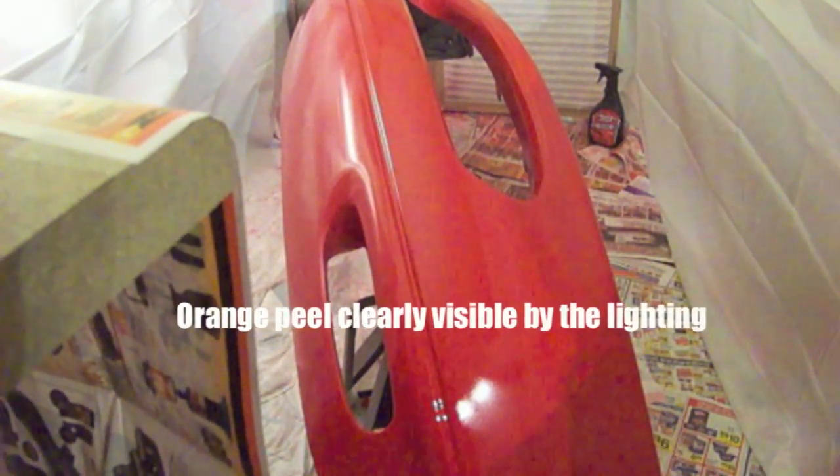Here we are as the second coat of the lacquer clear is drying, and it's looking at least uniform now, so hopefully by the time it completely dries we'll be able to do a quick wet sand with, I don't know, probably starting with about 2000 grit and going to 2500. Then we'll use a buffing wheel on a drill motor, which we will cover in a subsequent segment.